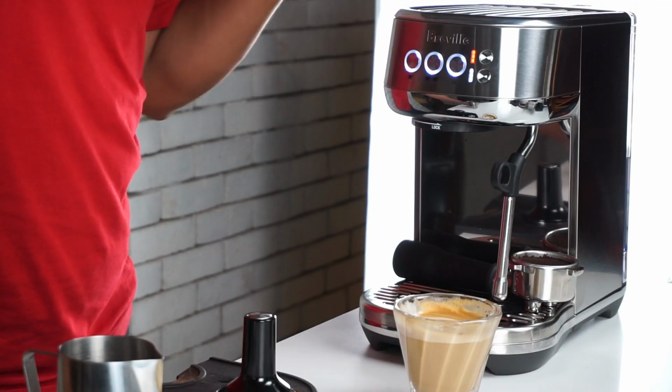So if you think about a traditional machine, usually if you're talking about the Barista Express or even the dual boiler, when you're doing shot after shot, 5, 10, 15 shots, one after the other, the problem is usually that the pressure in the tank drops, right? You lose power because you lose heat. There's lower temperature. This doesn't have those problems because it just uses a pump to get you up to pressure. But because of the way it heats water, it actually goes in the other direction, right? Instead of worrying about dropping temperature, you're actually more worried about overheating and burning your coffee that way.